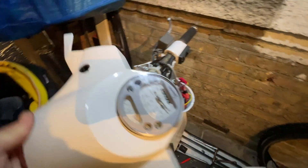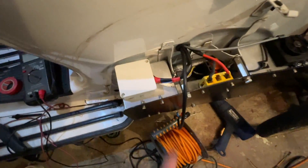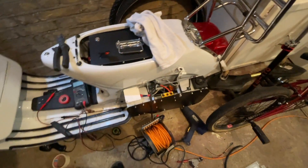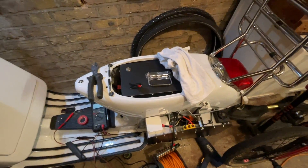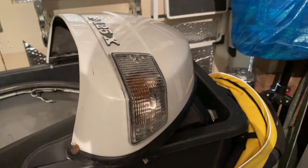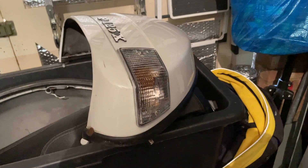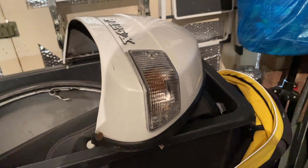I've got the throttle cable connected. The speedometer is connected, so that is actually all ready to go back together. Back here, I've plugged in the wires into the junction box, rerouted this cable through the hole again and plugged it in. I've got the box in and the battery in. Now all I need to do is prep the rear turn signals on the panels and hook up the rear brake, and then I think I'll finally be able to do a test drive. The wiring up front is nearly 100% back together — I'm just going to put my mirrors back on and my windshield. Now I'm just going to take the rear indicators apart, held in by a couple screws. I basically need to isolate the wiring from the indicator so it's no longer connected to the metal body.